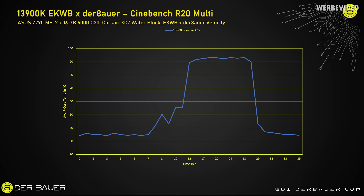Now looking at the temperature chart and results using the Corsair XC7 block — I also decided to leave the idle temperatures which you can see at the beginning, bottom left area, that is between 33 and 36 degrees Celsius. During load, which is about 20 seconds for Cinebench R20, we see temperatures between 92 to 93 degrees Celsius, and that's the average temperature across the P cores.